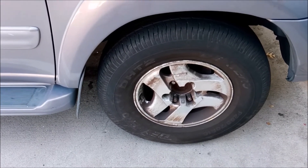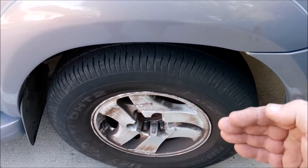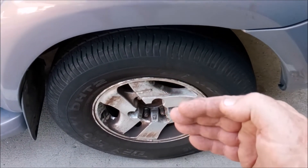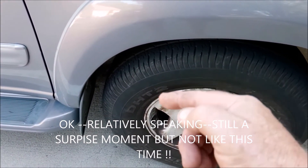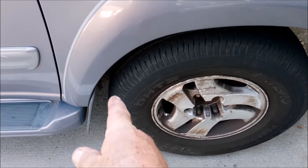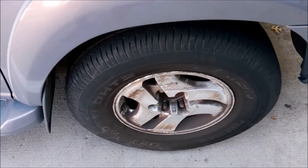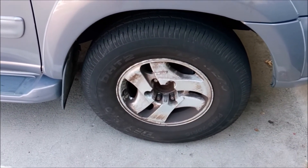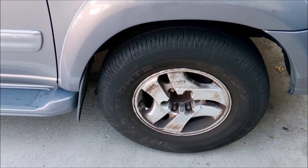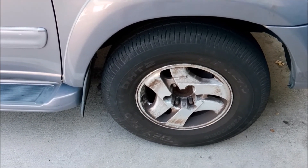The reason for the difference is on the old cars, you had a steering box up front and your tie links were up front. So if you lost a ball joint, because the wheel is trailing, it's going to tend to continue pointing forward — if it fails, it's going to pull the car but not violently. In the case of this vehicle with rack and pinion, the steering link is at the back end. So when that ball joint failed, the wheel is actually pushing on that steering arm and it just swings sideways. Heads up guys: if you even think you've got a problem on your front end, go ahead and get it taken care of way ahead of time. This was an astoundingly violent collapse, especially considering how slow I was going. Y'all have a great one — appreciate you watching.